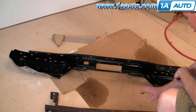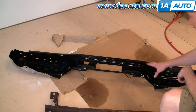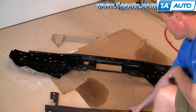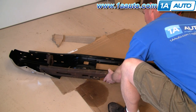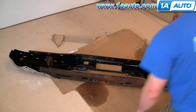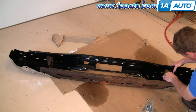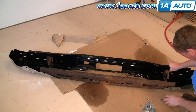I've got my new bumper laid down on its face. Here's the main brace that goes underneath. I did take some black paint and re-coated the backside of the bumper — put a nice thick coat on it. Didn't really worry about it running since that's where these things usually get salt caught up and rust from the backside. Hopefully that will make it last as long as the truck. Then this main bar — I've got a half-inch galvanized hardware from my local hardware store, with a little washer, lock nut, and nut.